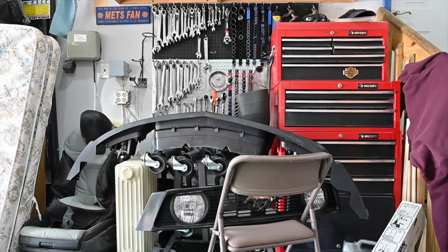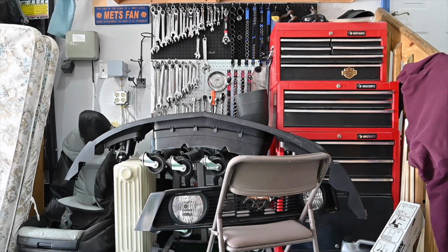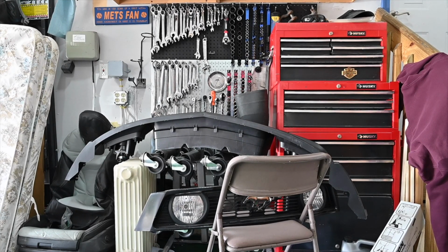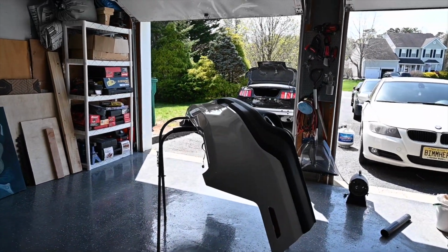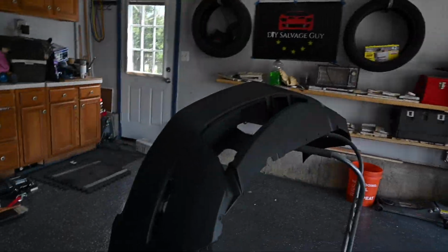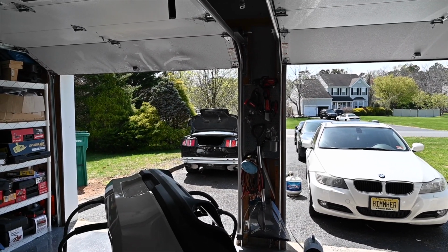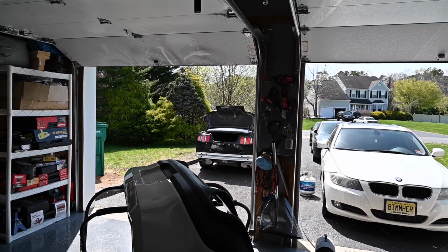And I think it'll pair very, very nicely with the updated aftermarket headlights that we have with, at your guys' request, the S550 look. So what we need to do is take this bumper cover off, get that valance done, and we gotta start sanding. So we gotta sand it, sand that. We're gonna prime. We're gonna get that seam sealed up over the welds. And this car is going to be painted very, very soon.